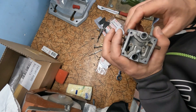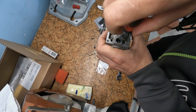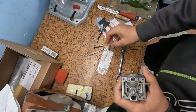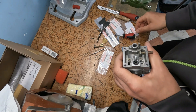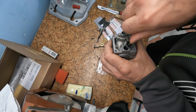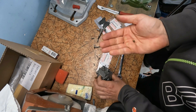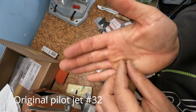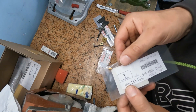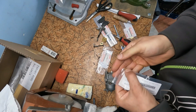Now I am going to remove the carburetor. Now it's the pilot jet's turn. It is located under that carburetor bolt. The original size is number 32. This is too small. This is the new jet. I will put on one size larger, number 34.